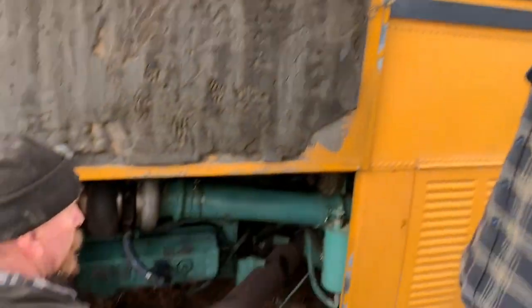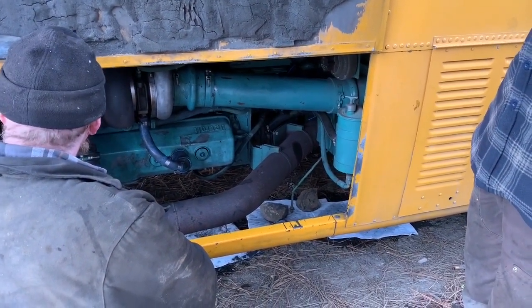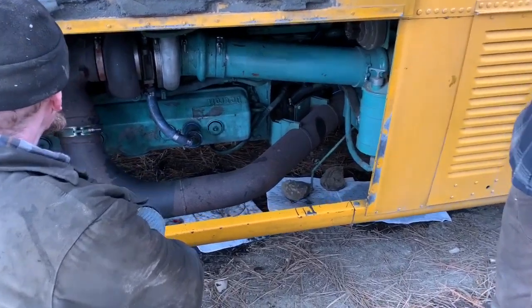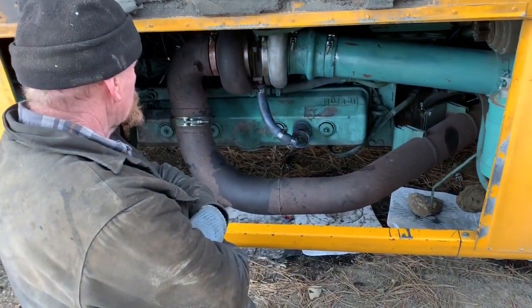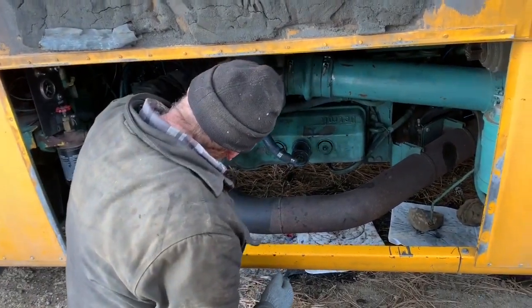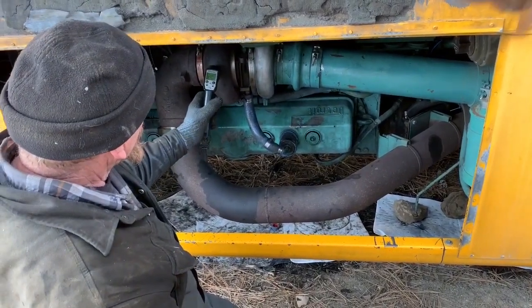Yeah, it is. But it's not black, it's blue. Yeah, it's definitely not the same. What is blue versus black? Blue can be oil. Oh. But again, we're not up to temperature. The exhaust is only 260 degrees. You can lay your hand on it. Well, a little bit. But it's only 260 degrees, 225 degrees.